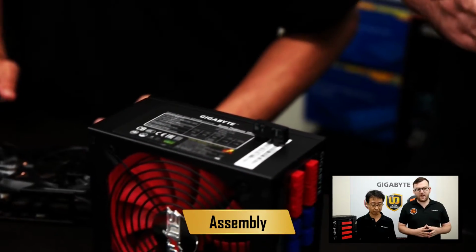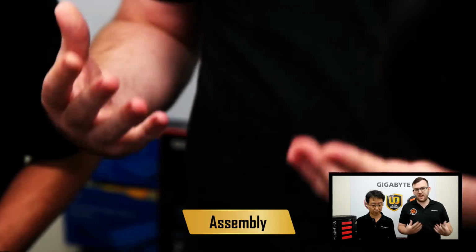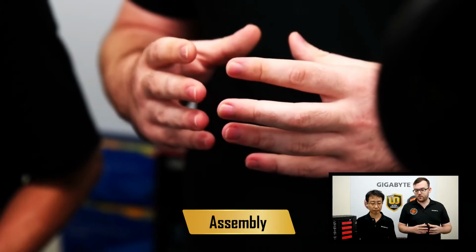And with the RAM, again, that's quite fragile. So if it won't fit in the first time, just do it again. The RAM has a small indentation on it, and this will line up with the socket. And if it won't fit in, just make sure it's lined up properly and push it in gently. When it's plugged in, you'll hear a nice click.